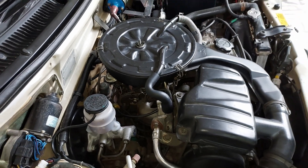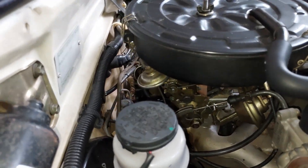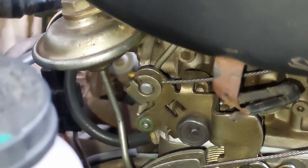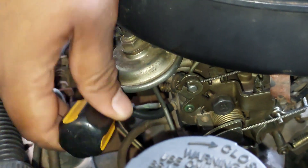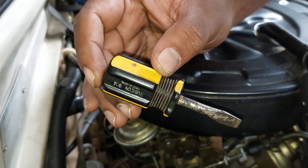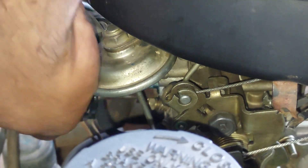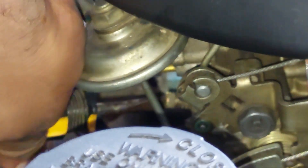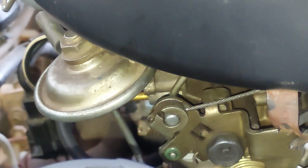Okay, now let's start the car. We have two adjustments: the idle speed adjusting screw and the idle mixture adjusting screw. Let's first dial in the idle mixture adjusting screw by fully closing it clockwise, then turning it anti-clockwise by one and a half turns. It would be easy to use a short reach flat screwdriver, because adjustments by hand are almost impossible with the air filter in place. So let's fully close it, then open it by one and a half turns anti-clockwise. Now let's try to start the car.